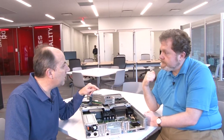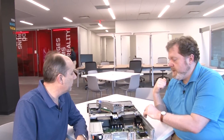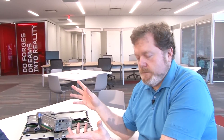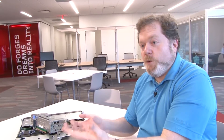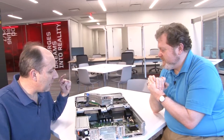The CNAs have two additional offload engines — that's where the 'C' for converged comes from. They have both an iSCSI offload engine and a Fibre Channel over Ethernet offload engine. You can run one or the other, or both if you want. Most customers pick one or the other, but technically you could run both protocols through one card.